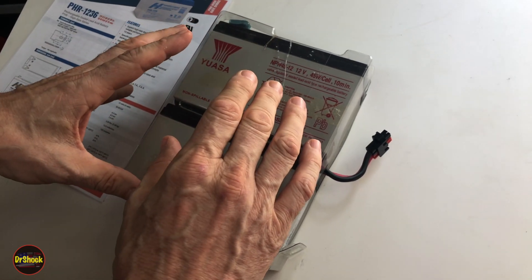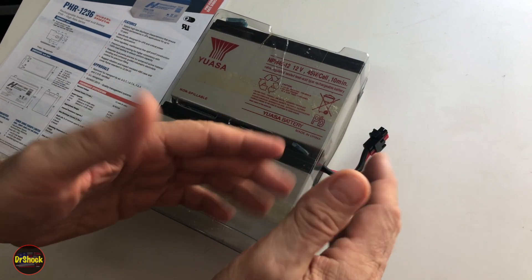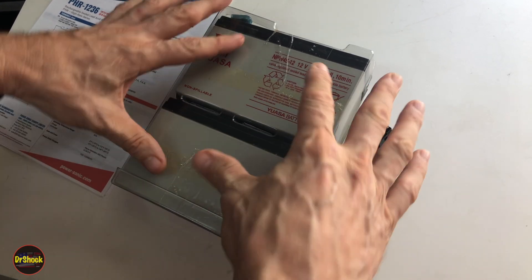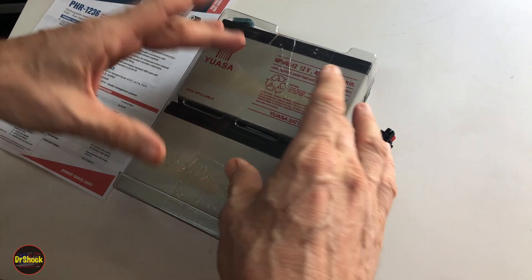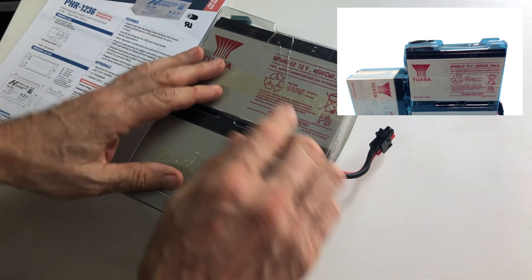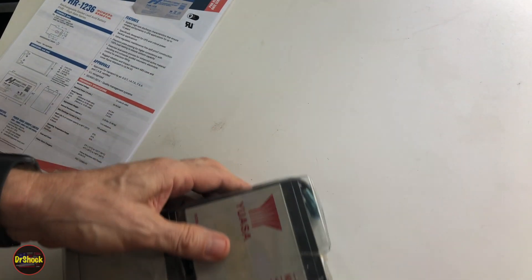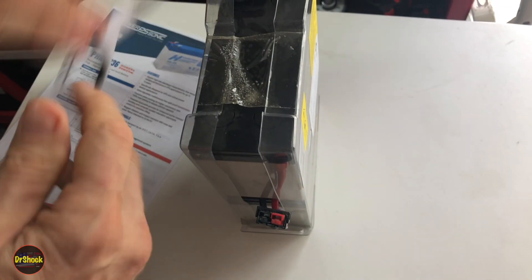For the 5396 machine type from IBM or Lenovo, look at the three characters after that in the model number. If the first character is a '1,' it's going to have two batteries. If the first character is a '2,' it's going to have three batteries. I'll put a picture up showing what the three-battery model looks like.